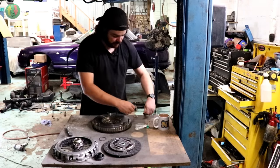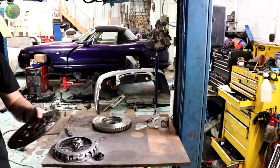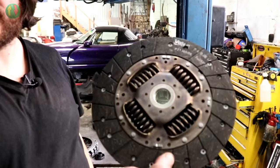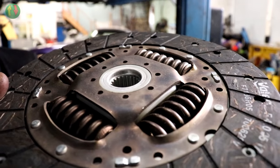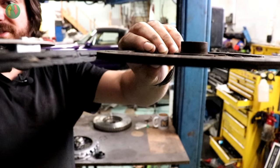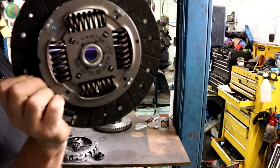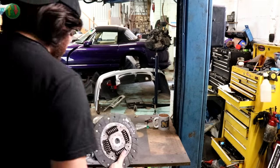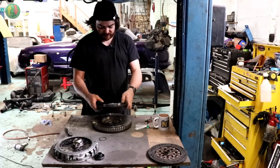Comparing the old and new clutch friction plates - the old one is very thin and shiny where it's worn down, the new one is a fair bit thicker. It's cleverly labelled: 'gearbox side' is marked on there, made by Valeo. The gearbox side protrudes outwards so that it sits in the flywheel, which has a raised surface with a small lip on it.